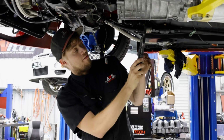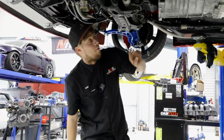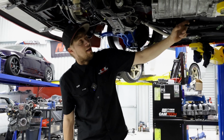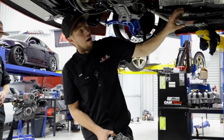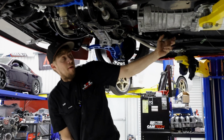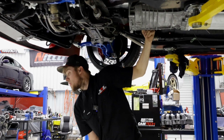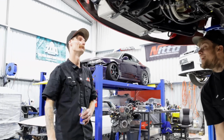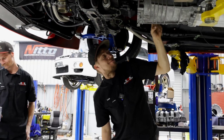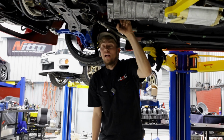So instead of using this and a factory setup and having to get a new clutch made, what we're actually doing is getting a perch machined up that will sleeve inside there, and on the back side we're going to weld it in so that it's permanent. Then we've measured so that perch will sit our internal... You're all right, bro, just take your time. That perch will house our concentric slave, so that we can retain the clutch that we've already got.